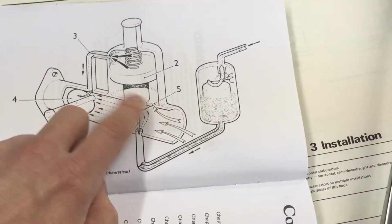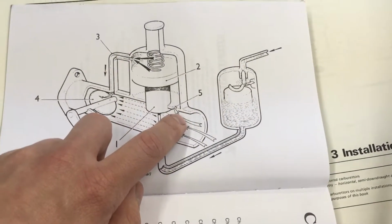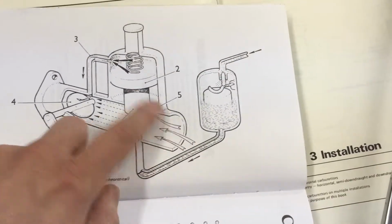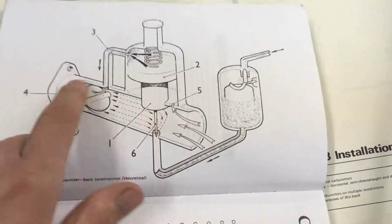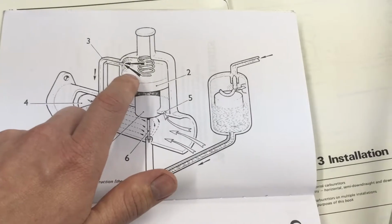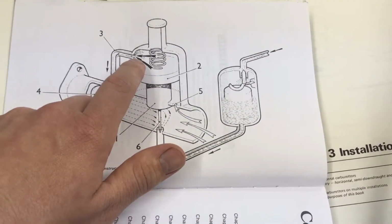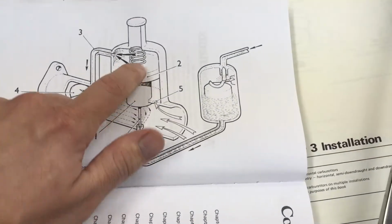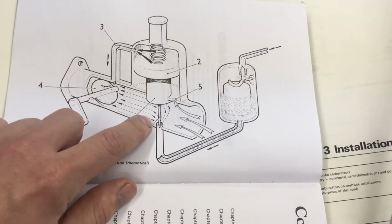Now, the area below the piston is more closely connected to atmospheric pressure because the inlet for that is right here. So when the air rushes over here, you're going to see another pressure differential, the same way you see across here, that causes the rushing of air. You're going to see it inside the piston, and because there's much lower pressure above the piston than right here, the piston is going to rise, and naturally that needle is going to rise as well.